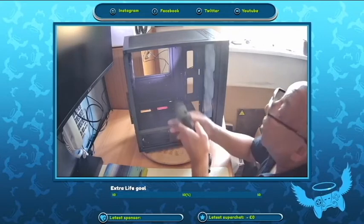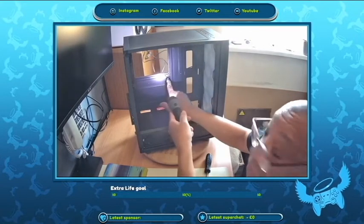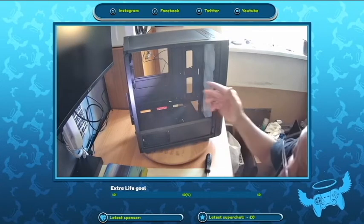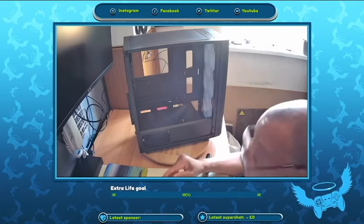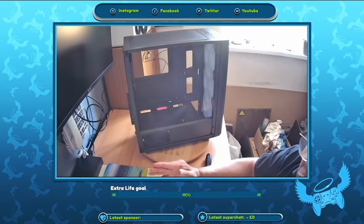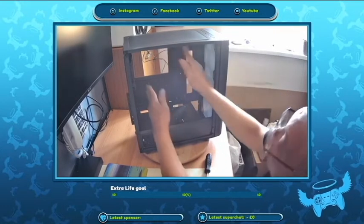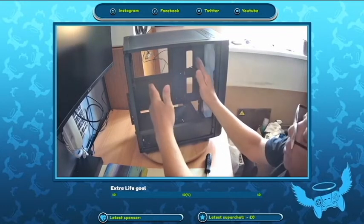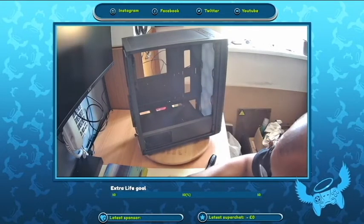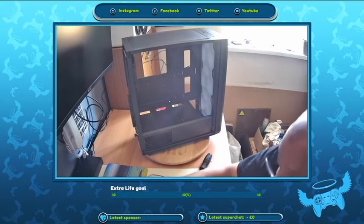It's got ports. Oh, good. So it's got 1, 2, 3, 4, 5, 6 standoffs already, 2 in the back. Obviously, if I've got a larger motherboard, because don't forget some ATX motherboards are that way in height, the way they're made, and some are made slightly larger that way, shorter that way, but longer that way. So obviously they've accommodated for that. So I've got 2 extra standoffs in there, plus all the screws from all of that.